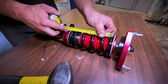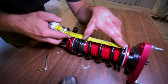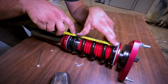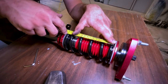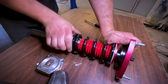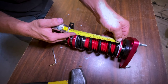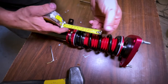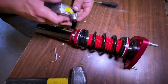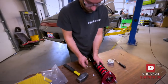So we're going to see what this spring measures to. It looks like the base of it is a sixteenth under six inches, so we'll go up to five and seven-eighths from five and fifteen-sixteenths. I would use millimeters but I hate fractions — this is just easier for me. So all we do is spin this up and crush the spring until it's at our desired height or pressure. That's gone too far a little bit. The nice thing is when you measure one spring, the other spring is going to be the same, so you'll be able to check and see if the preload matches. Now we're at five and seven-eighths, so let me snug this up.